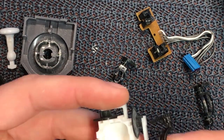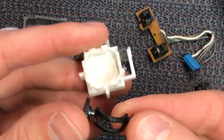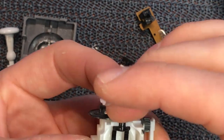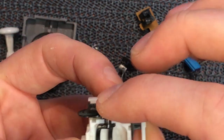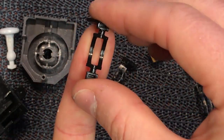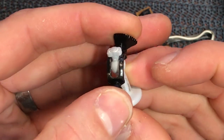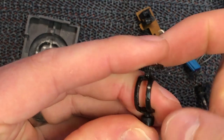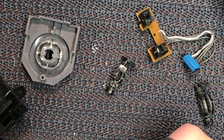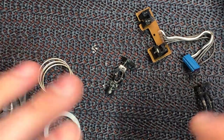In an effort to repair this, we order new plastic carriages or brackets. These are brand new and I'll show you where to get them — they're aftermarket but very high quality. I've only found one seller that sells these; they're about three dollars Australian as a pair. They're a tighter fit, which is what you want, and they're nice and straight so they hold a really nice bite against the bottom of the joystick. The joystick moves this whole rail and you want extremely tight tolerance. At this stage, I think we should take it outside and wash it to get rid of all this powder.